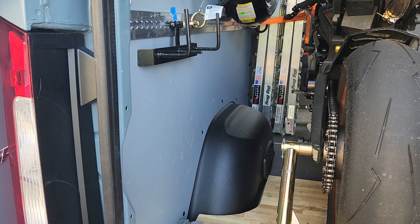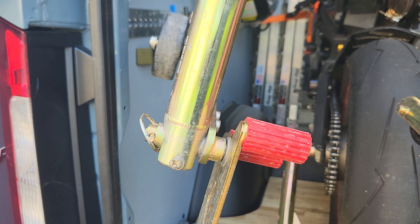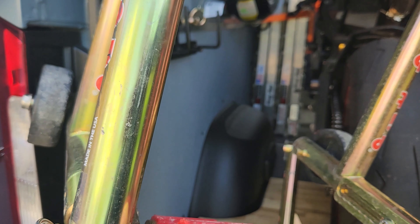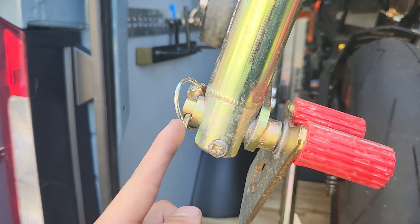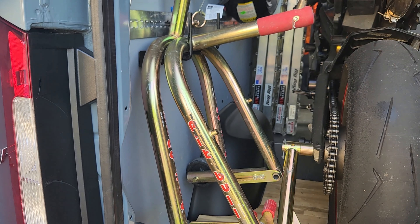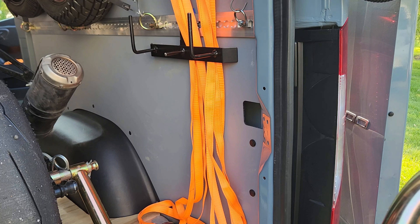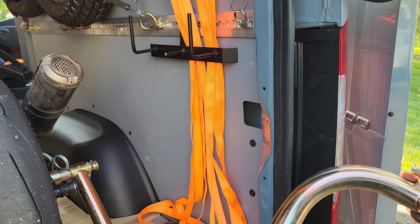Now I'm going to do the two front stands. In order to make them fit, I remove one of the front stand caliper holders from the Pitbull stand. The reason I do the front stands lower rather than the rear stands is that the front stands are smaller in overall width from arm to arm, and these caliper holders are much easier to remove — on the rear stands you have to unscrew a screw, but on these you just pull out a little safety pin. I simply drop it into place; with the caliper holder removed, there's no clearance problem.